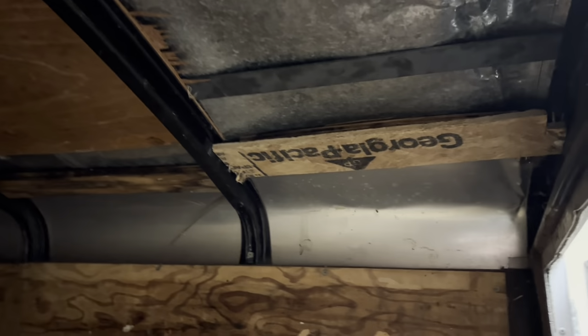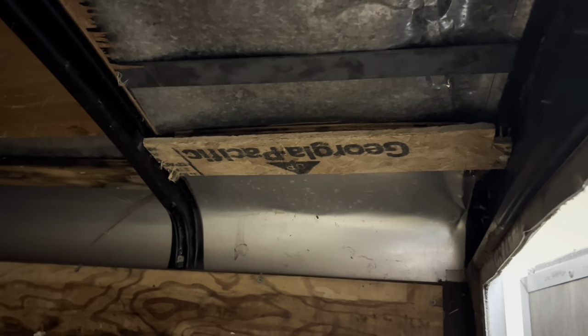The owner of the trailer came by and we talked about it, and it's a good idea. It saved us from having to completely rip it apart and having to spend more money on some more metal. So it's really good. I like it. We just went in and scabbed in some pieces of plywood and a little bar of metal there and just gave it some support back. That way, you know, it's not holding water anymore and it should work.